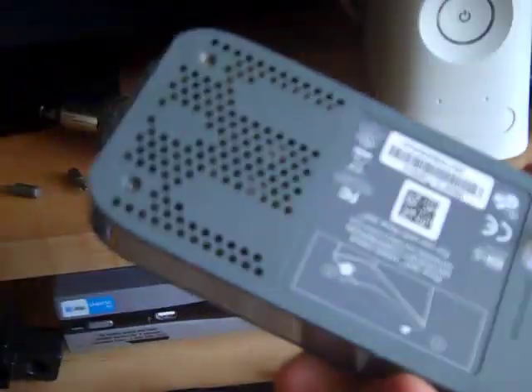And something to put the screws in when you take them out — I just have a bowl, piece of paper, whatever. Now take out the hard drive, press the button, let it go. Mine's only a 20 gig hard drive, very small, but the same process will work for all other hard drives, including 120 gig, 60 gig, or whatever you have.